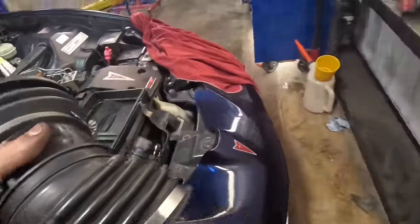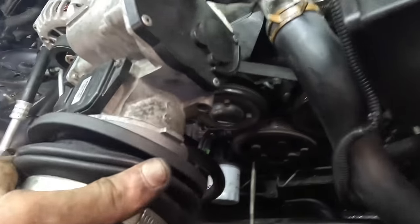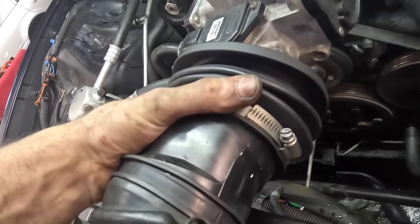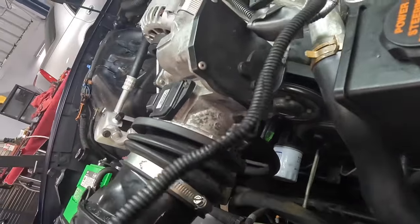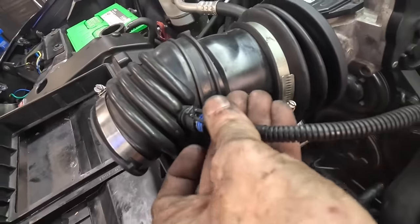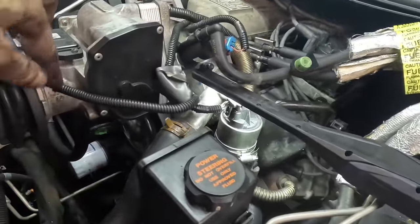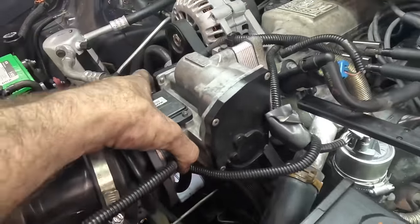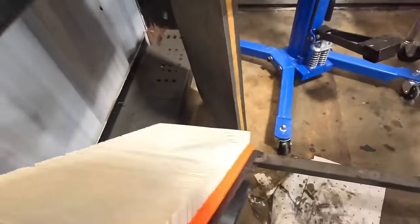Okay, intake piping. It's gonna plug in right here to the throttle body. Let's get that guy set up and get on there. It just kind of fits with this piece of rubber. No clamp or anything on this section. It just sort of goes on there. We have an intake air temperature sensor connector. That guy goes right in here. There's the sensor inside sticking out right there. Can't see. And then this guy, I believe, was zip tied just over here somewhere, so we will re-zip tie that in a moment. Let's get the filter and the filter lid. That's next.